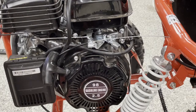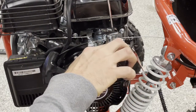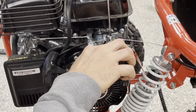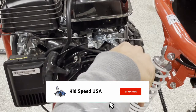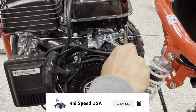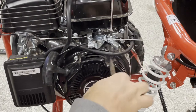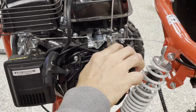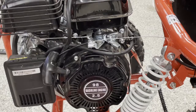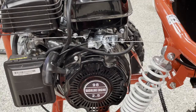Really easy to do. Grab a hold of this bolt here with your pliers and loosen up this screw. Then just pull this cable through until it's nice and tight. Get good tension on that and then just tighten the screw up again — get it really nice and tight. Now we'll see when I press the throttle, it's really responsive.